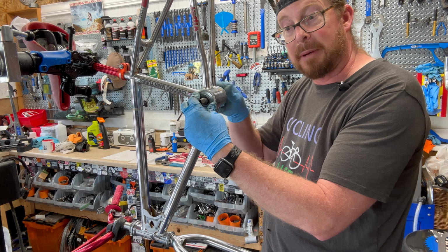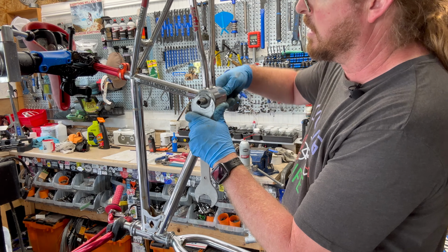about in between. Then the lock spacer on this particular one, same thing, it'll have a beveled edge. The flat, beveled edge outwards. Lock nut, see how it has kind of like a oomph, and the tapered's as well out, like so. So you'll be able to adjust these two by, like hubs, you back it off and you tighten this down, because that lock washer should hopefully hold it in place, like so.